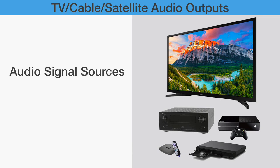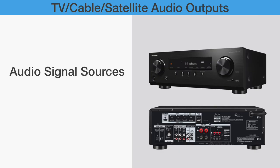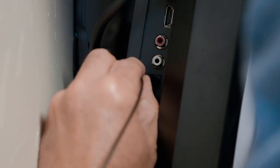If you enjoy TV programs from multiple AV sources, such as cable box, DVD, streaming media like Netflix or Amazon Prime Video, then it is best to hook up your chair speaker transmitter unit to the TV's audio output directly. If you only enjoy TV programs from one fixed AV device, such as a cable box or Blu-ray disc player, you can set up your chair speaker transmitter unit to that AV device. If possible, hooking to the TV directly is the best option.